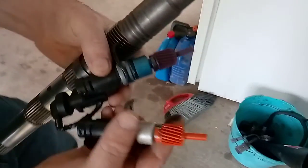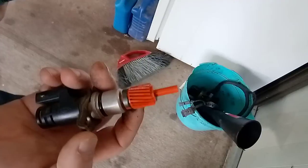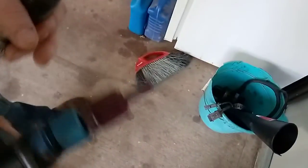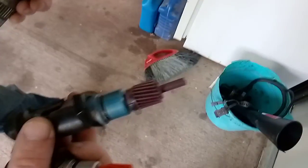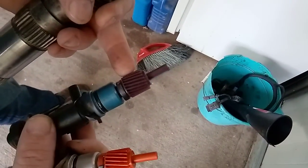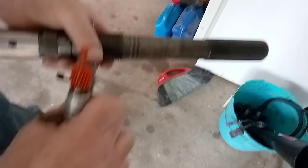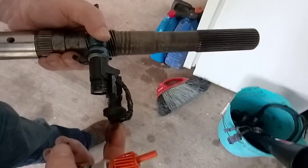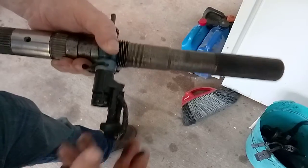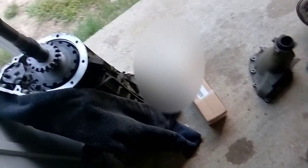Okay, eBay - this is an orange one that came off of mine; it has 20 teeth. This one came off of an earlier model Expedition, late model E4OD - this has 21 teeth. So it rides against it like that. It's just like an old-school speedo cable except it relays an electronic signal to the speedometer and to the PCM to tell you how fast you're going. Some have differential speed sensors; some don't.